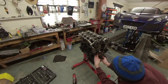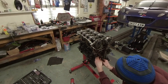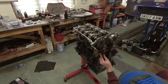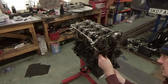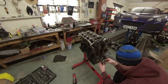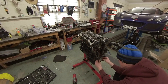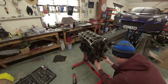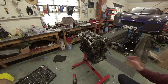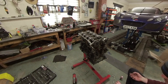Then we'll put on our moving timing guide — this is the one that's held in place by the timing chain tensioner. When we install it, we just have to make sure this tab is in the slot that's designed for it. Then put on our crankshaft position sensor plate; it can be a bit tight to get on, just give it a wriggle. That's nicely in place, so now we can actually put the timing cover on.